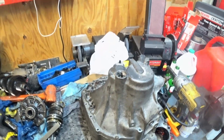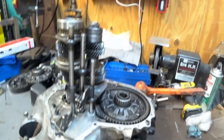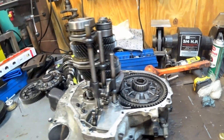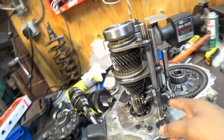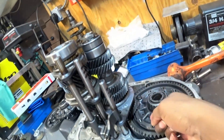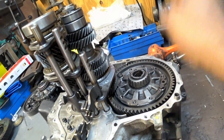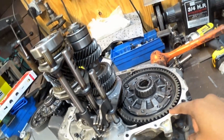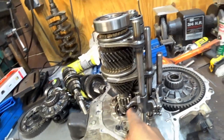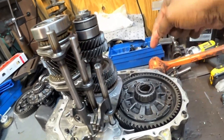If that works, the transmission should be good and ready to go for spring season. We finally have the transmission completely mocked up — this is more or less what it should be. The selectors are in place and these are all CRV — they fit into the H22 setup, which is why I'm running those. This is the H22 diff with the Prelude Gen 3 final drive because I switched the counter shaft, and it has the CRV all-wheel drive ring gear at the bottom.